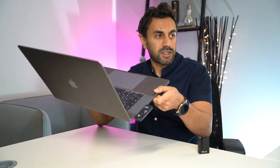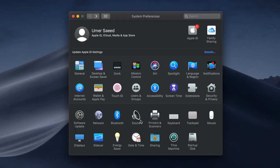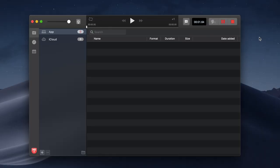The last thing I want to do is set this USB-C receiver up with my MacBook Pro to change the audio input to the wireless mics. I'll put the receiver into one of the USB-C ports on my MacBook — as you can see it's connected, with one blue light active. Go into System Preferences, click on Sound, and in the Input tab select the USB-C advanced audio device, which is this Comica microphone, and you're ready to go. I'll record using a voice recorder app to play back audio coming directly from the Comica microphone into the MacBook Pro via the Thunderbolt port.